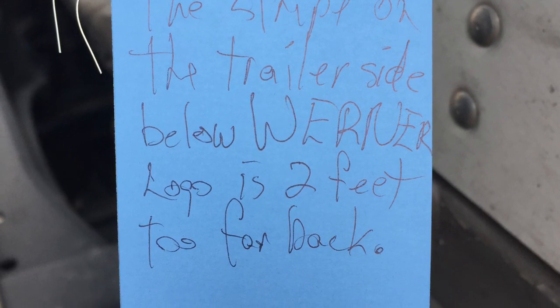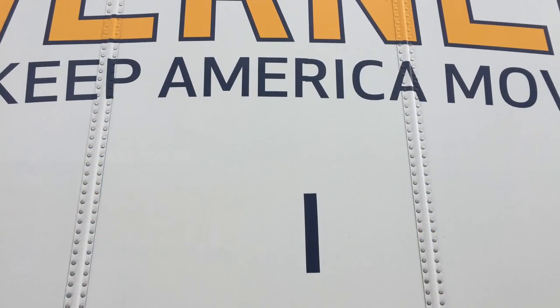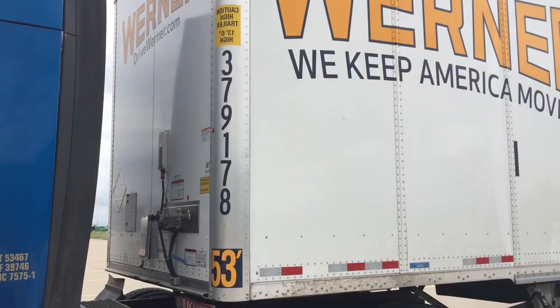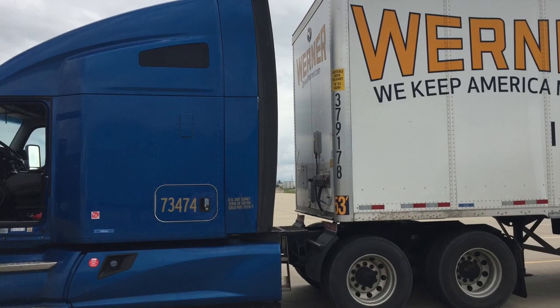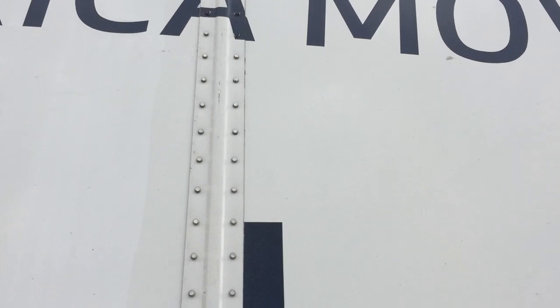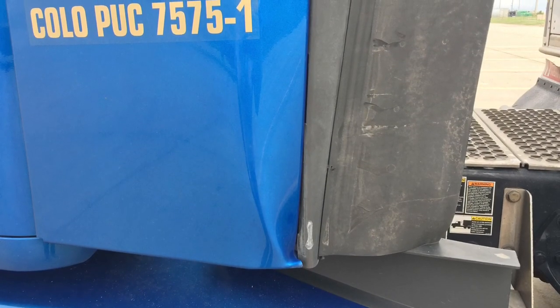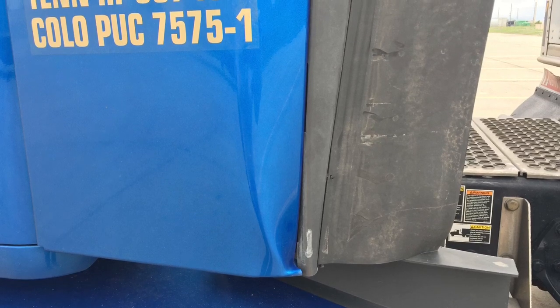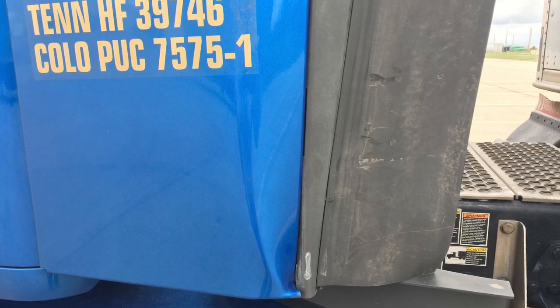So let me show you what I mean by that. Look at these two trailers — see where that little vertical line is, the white and black stripe? See where it is located on that panel? Now look at where it was on our trailer. Too far back. You see you have two whole panels before they put that stripe. So somebody put it on incorrectly. They had been taught at the Werner orientation to use that stripe to do their 90 so that the cab would not hit the trailer. But sadly, look what happened — it collided with the trailer. So please, when you use that method for the Werner trailers, be sure to look and make sure that that stripe is in the right location before you use it to try and make your 90 degree turn.